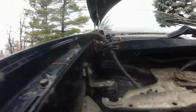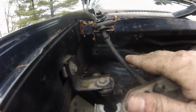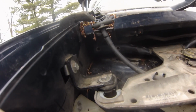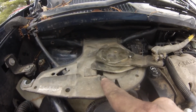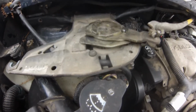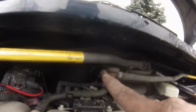Just to recap, these two bolts, 10 millimeters. Be very careful if you try to take them out because chances are they are going to break. Mine did. I'm going to weld them back on there, so I'm not worried about it right now. That's 10 millimeter as well. These are a Torx T37. There's 4 of them. There's one under here, there, and there to drop your motor. Right here is a gear, so you gotta loosen that out. These are 8 millimeter screws, or bolts, sorry.